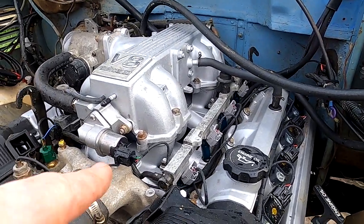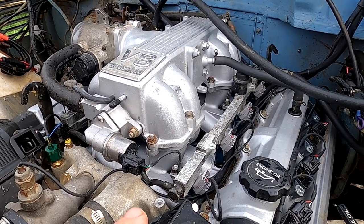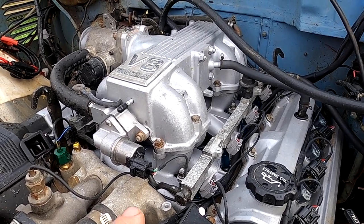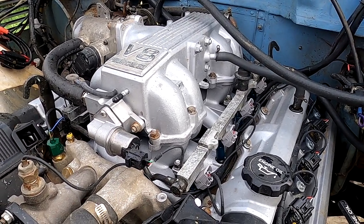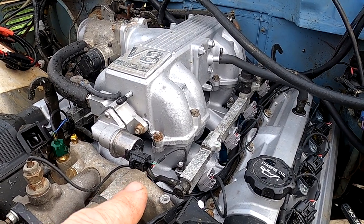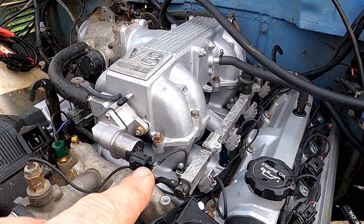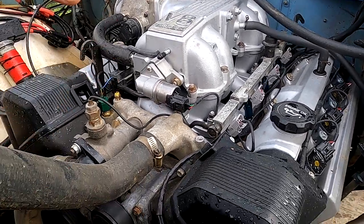New injectors. They're 250cc's, a little bit bigger than it was in there, but not too big that we had to do massive changes in the tuning and cause massive problems. Even though I put a different tune in it. There was a good Link base tune for a UZ back in the day, and the base numbers worked reasonable. So all that kind of works like it should.